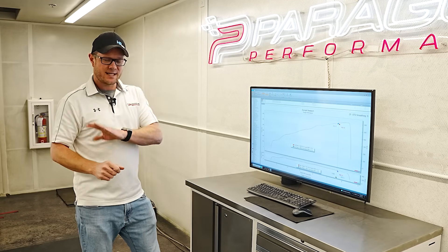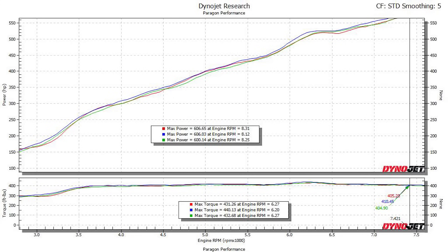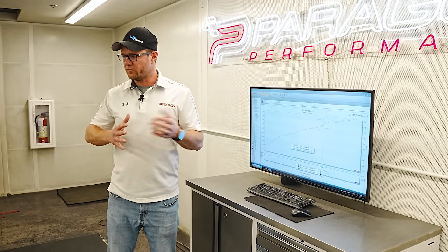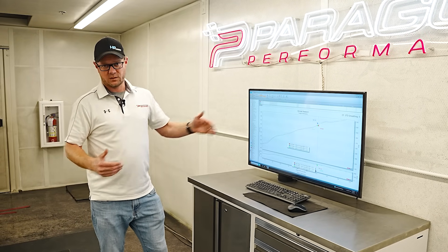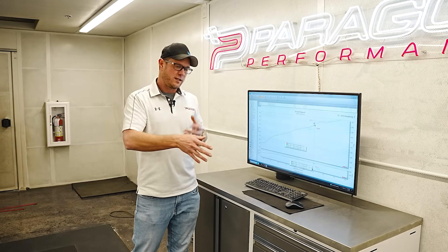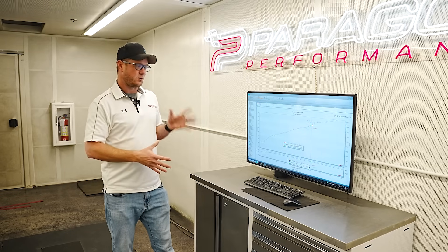As a test, we actually did reset the ECU after our baseline testing to see the difference. We lost quite a bit of power — peak horsepower dropped to 600 and torque dropped to basically 432, pretty similar to stock. Zooming in, you can see there are quite a few places in the power band where we've lost power. The reason is simple: it's running less ignition timing. These cars have a full-time fuel control system so fueling is always on point, but the ECU varies the amount of ignition timing based on learned octane. After a reset, you'll see lower values until run after run slowly works the timing back up. This is why it's important to do consistent same-day comparison testing — if you dyno on one day, put headers on months later and re-dyno, you might not see numbers that make apples-to-apples sense.